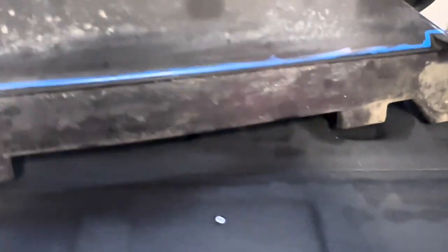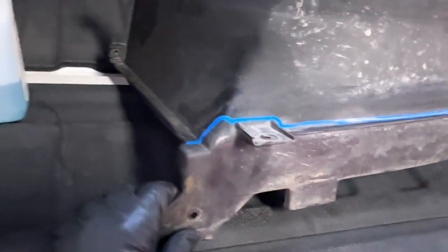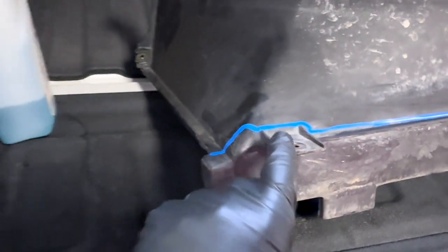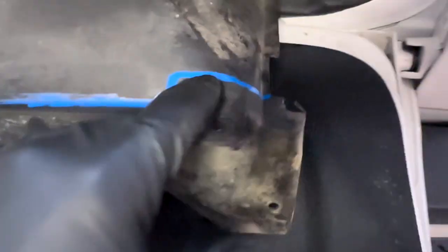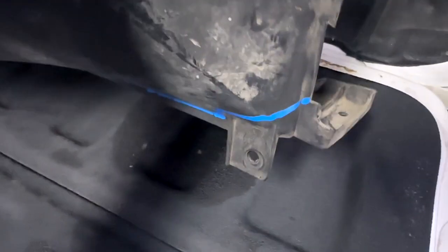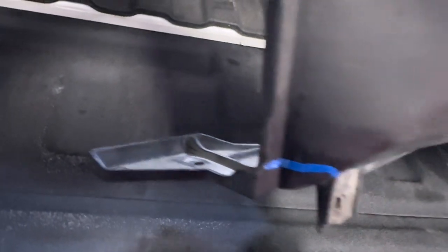The shroud is an integral part of the radiator mounting. So at our handy dandy truck bed tailgate table here, I'm going to cut the lower shroud. It's already broken — I'm not cutting anything in good shape — but this will allow me to keep the radiator in the factory location. We'll just go down through here and cut across, and that still leaves the pads that the radiator sits on, on the radiator support. Let's get to hacking this thing up and get it back in the car.